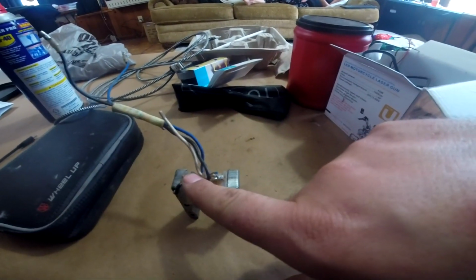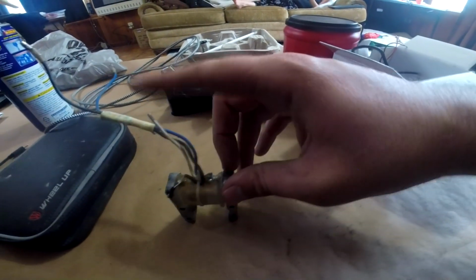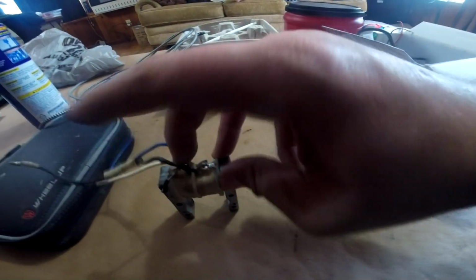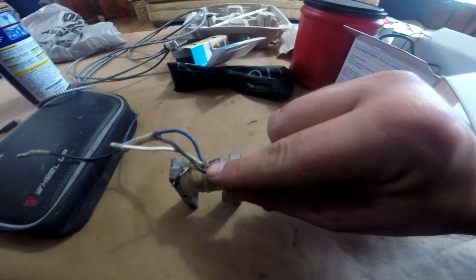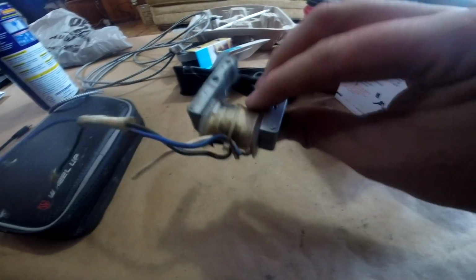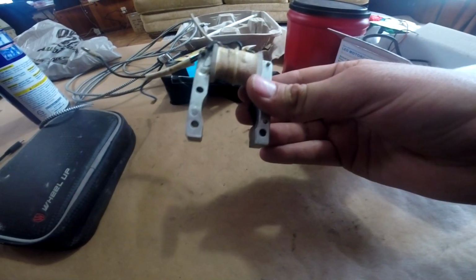As part of the troubleshooting phase, I decided to go ahead and test the stock magneto that came with the motor. Because it had the white wire, I assumed that it might have some auxiliary power connection or a separate coil. Well, after closer examination, it turns out that the white wire that comes in these kits is literally just soldered to the same terminal as the blue wire, meaning that this is not going to help at all. But if you were curious, now you know.